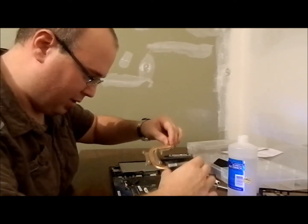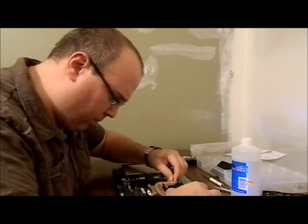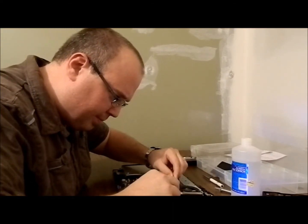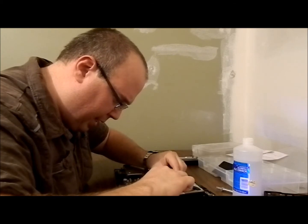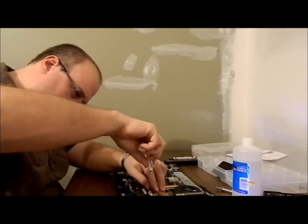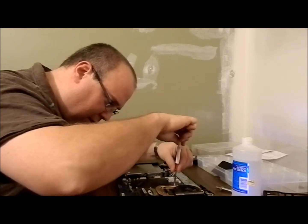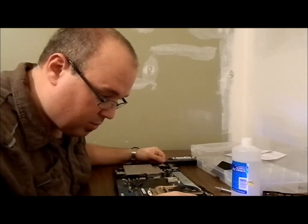What we're going to do — I'm going to lay this down here, but we gotta make sure that we lay it almost bang on top. We don't want a lot of movement around when we're putting this down — we don't want to slide it around all over the place. Okay, so I'm just going to lay that down. Boop! Pretty good. Square it on. I'm going to do up the screws here. Now, you don't want to over-tighten the screws because you're screwing right into the motherboard — you don't want to strip those screws or damage the motherboard at all. That'll be mondo expensive and your friend will punch you in the head.